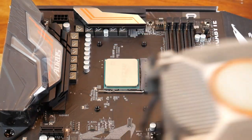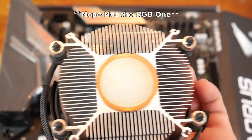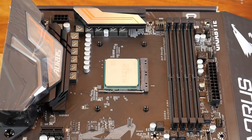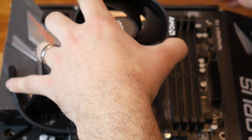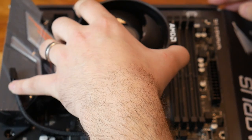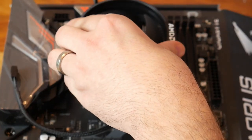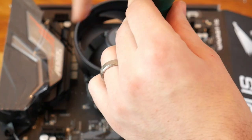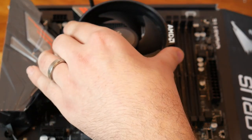Now let's look at the Wraith cooler. I believe it's the RGB one. There's some thermal paste underneath — it looks like it's already exposed because the box has a sort of cave-in to protect it. We'll line it up in all four corners. I've decided to put the AMD logo on this side for better cable management. We'll give it a couple of turns in opposite corners with a Phillips head screwdriver — you need to keep that backplate in place.